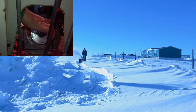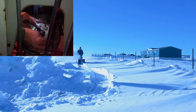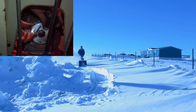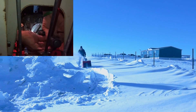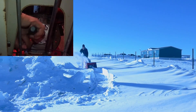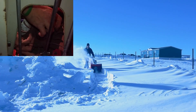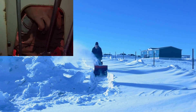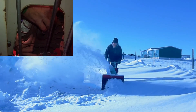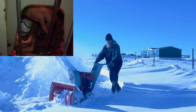This thing is an actual beast. I installed the flywheel — it is quite a challenge to get the keyway lined up — but I did that, installed the recoil mechanism and put that back together. I actually had to fix the drive assembly as well. I call it 'frankenblower' at this point. It does work, but it kind of beats you to death — quite a challenge wrestling the machine.